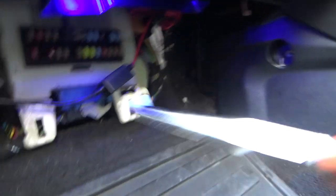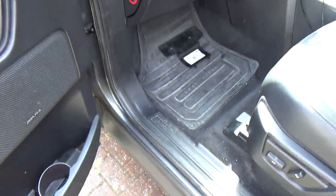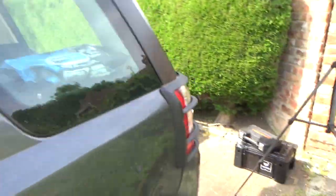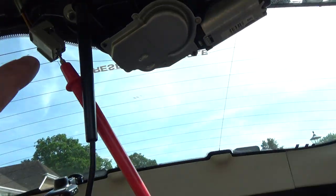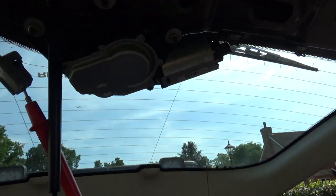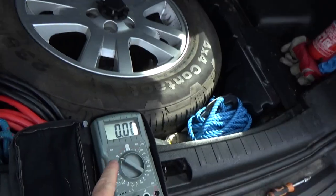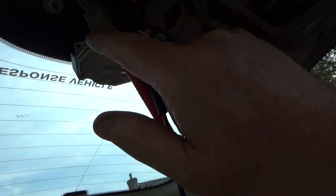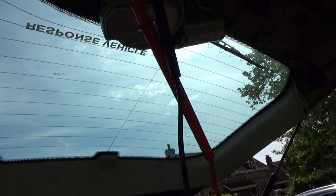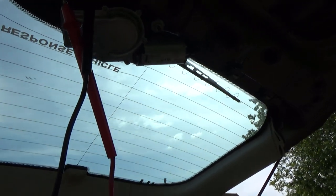There it is, blue 15 amp F20. Okay, I'll just put that there for now. And what we should find now, hopefully, is yes, okay. So that's stuck in that middle pin, and we've got measuring basically between the chassis and that yellow purple. That was giving 12 volts, it's now zero. What I'd like to do is test the other pin, the green purple, and just make sure that that's dead as well. I don't really want to do anything with this until it's all completely isolated.